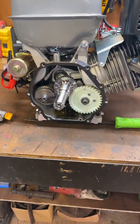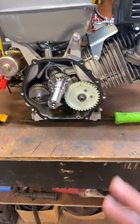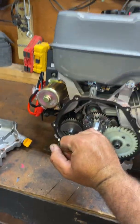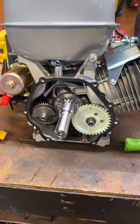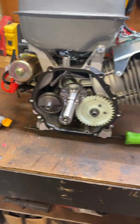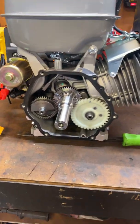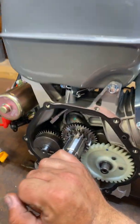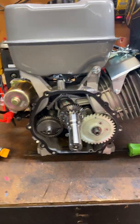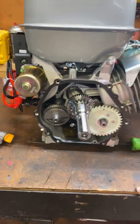So if you're out here in Canada and you want to build one of these like the guys down south are doing with the Predator engines, most of the stuff will work, but you're going to have to get a new crank - you need a crank from a Predator 420 if you're doing the 420. I can't speak for the 212cc, I've never torn one apart. Even a crank from a Honda won't work because they're a shorter throw - these are actually longer stroke than a Honda engine, which is why they get 420cc whereas the Honda only goes up to 390cc.